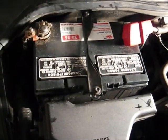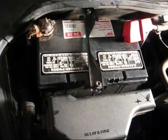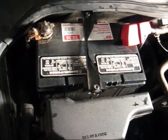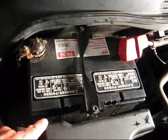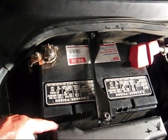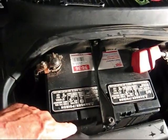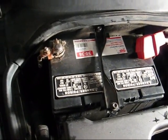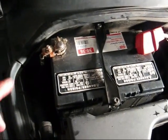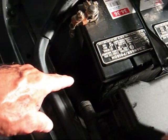What can happen, depending on how the car is made, is that battery acid can drip down onto other components. For example, in the C5 Corvettes, the battery is prone to leaking — it's what's called a side terminal battery. The side terminals were below the level of the battery acid, and what's right underneath is the engine control module. Battery acid goes down, damages the ECM, and instead of just replacing a battery, you'd be replacing a very expensive component. So when you see a battery that's wet around the top, leaking down the sides, or dripping to the bottom, you need to replace it.